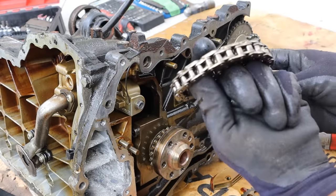Here's the first main bearing — it's only got 2 bolts per bearing, as opposed to 4 or 6 bolts in a V6. This is an E-Torx 10 for the connecting rod bearings. Taking a look at all these connecting rod caps, you can see there's definitely some wear on the coatings — not too much scoring, maybe 1 or 2 lines. Here are the main bearings for the crankshaft; once again these are in good shape with just some very minor scoring. I'm going to remove the crankshaft and push the connecting rods down so we can get the pistons out.